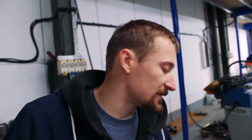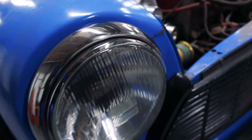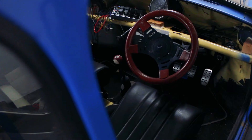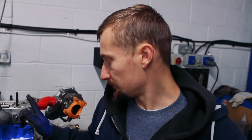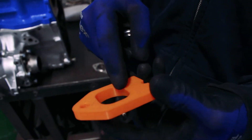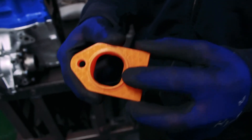I'm going to start fabricating the manifold on a block that Specialist Components have sent me, which is on the bench. It should be a simple process to get the manifold mocked up. The cylinder head they sent has been ported out basically as big as they ever go, and they have a kind of rectangular port shape. So I've 3D printed some transition flanges to go from that larger rectangular port into the inch-and-a-half primary size we'll use on the two outside ports.